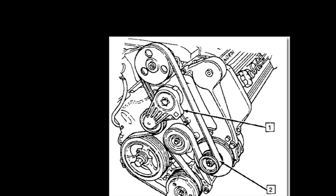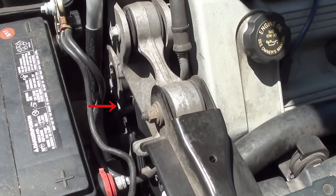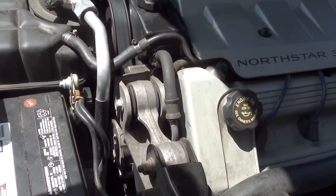What we're looking for is number one — that's the tensioner. On the tensioner there's a little square, it's a half inch. You can put your half-inch socket there where the red arrow is, or buy the tool that will fit in the tensioner. Once it's in there, you're going to turn it clockwise, towards the front of the engine. I had to buy the tool because there's a tube where the air conditioner runs through, and I really don't want to touch that — once you bend or break it, it's going to cost a lot of money to fix. You can pick it up at Harbor Freight for about 18 bucks, and it's worth it.